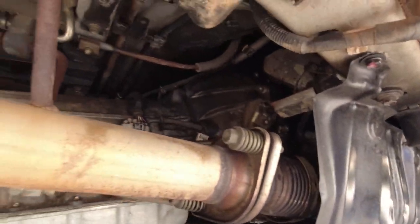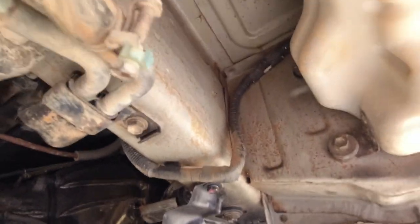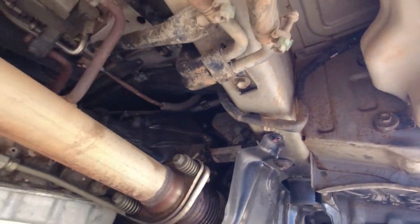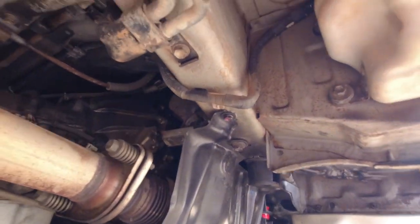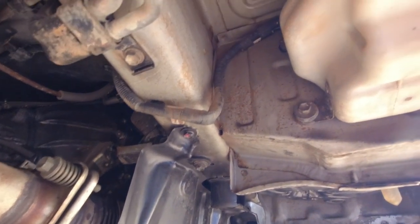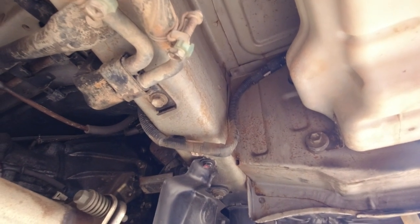And basically you're just looking around the entire vehicle, the body again, the chassis rails down both sides. This isn't rust, this is mud. And you're just having a really good poke around to make sure that the body is relatively rust free and the chassis rails are again symmetrical on either side, driver's side and passenger side, that it's not dented up, pushed in, that people haven't drilled a whole bunch of different holes in it for no reason to mount, you know, neon lights, things like that, which I have seen done on even four-wheel drives.